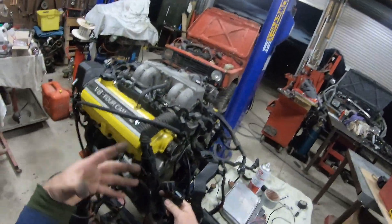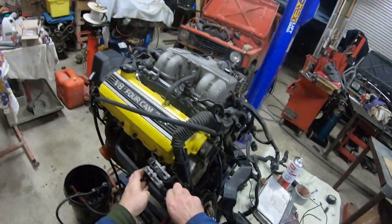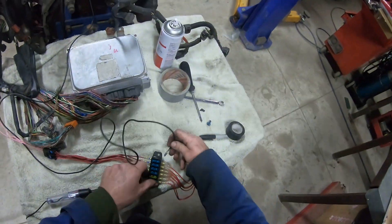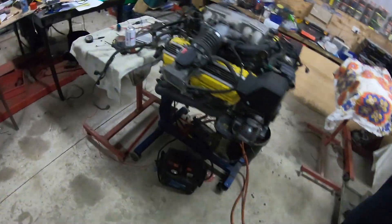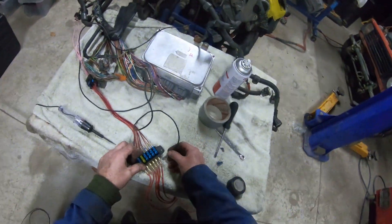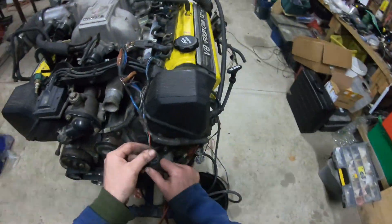Okay, it needs one of the igniters to run — we'll plug them back in, we kind of knew that. I've still got both cam sensors disconnected. It will not start — also the battery's getting down. We've got some jump power. It's sounding like a tractor, we don't care about that. Okay, no run — we'll give it one cam sensor.